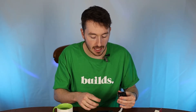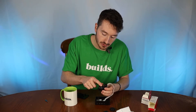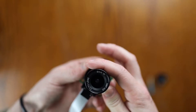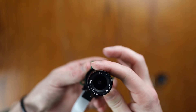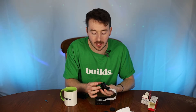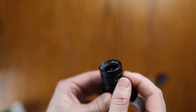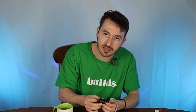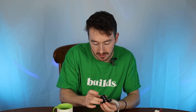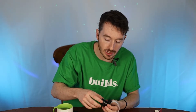Now we're going to go into adjusting the focus and things like that because I found that was probably the most difficult part — the software was the easiest. To actually adjust the camera, you have a few options. The first one is right here: opening and closing the lens aperture. The more open it is, the more light that comes through; the more closed, the less light. To adjust it, you just need to loosen the screw with your hand — run it left a little bit — and that'll give you free roam to open and close the aperture at will. Set the setting you want, then tighten it and it's locked into place.